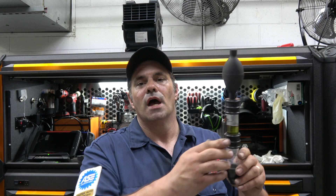A couple of important things when dealing with these: don't use it in a closed shop with exhaust not vented, because that will cause false positives. Also, don't get coolant in here — again, false positives. And make sure you don't expose this to exhaust; if the guy in the bay next to you is revving, testing for a misfire or something, that's probably not a good time to test.